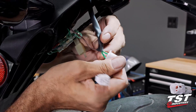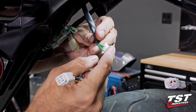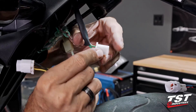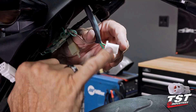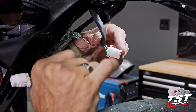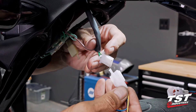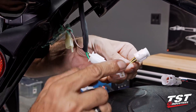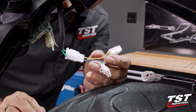With the lock window on this side, looking at the supplied plug: brake wire here, ground here, center position left open. Plug this in here and now we have the opposite side to take care of.